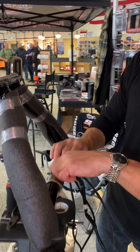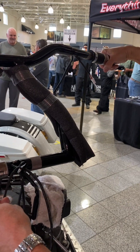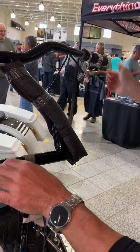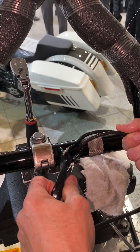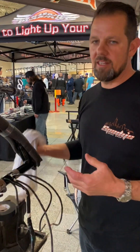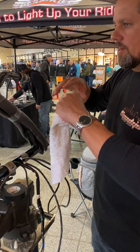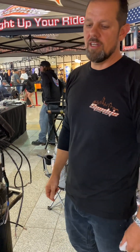I'm going to take the Harley hand control wires, push on the top, pull them through. Leave a couple inches so we can put the controls on. Heated grip is all the way in — that's bottomed out. There it is, everybody. So we just wired a set of our bars with heated grips and LED turn signals — this is about as complicated as it's going to get. It's a lot easier when you do not run heated grips and when you don't run the LED turn signals. You can see how fast we just did this by myself here at Laconia Harley. You guys can absolutely handle this on your own with just a little bit of patience and a lot of lube.